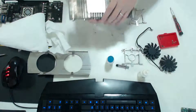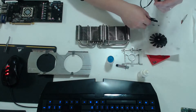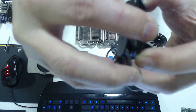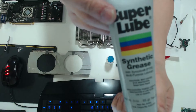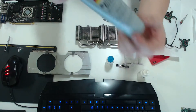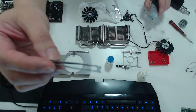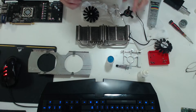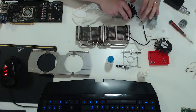After you clean, you can see how it's all shiny. After that's all done, I actually brought it outside to clean and sprayed it down with compressed air dust busters — I'll leave a link for those. If you have a brushless fan motor, you can actually take these things apart; they come into two pieces. The next step: I took them apart and used this product called Super Lube synthetic grease — I'll leave a link in the description. That gets applied inside the little fan motor and also on the little rod that sticks up in the middle, because these things spin and you don't want a lot of friction. It also helps with the noise. I just used a little tweezer, took a small amount, and applied it.